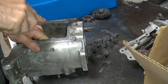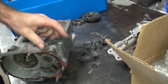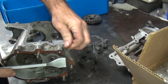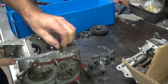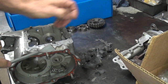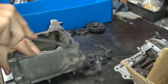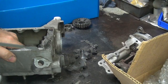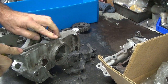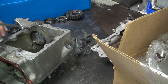So as you're cleaning the gaskets and stuff up, you get a good opportunity to look at things while you're working on it. You look for things like holes in cases and stripped out threads, previous repair work that was done adequately wrong, crappy silicone everywhere. That means you gotta check every orifice everywhere because that crap is everywhere. That's why you see no silicone up here — I don't like it.